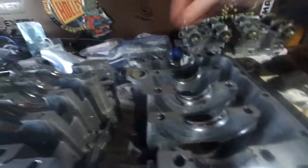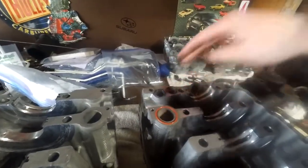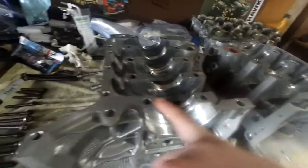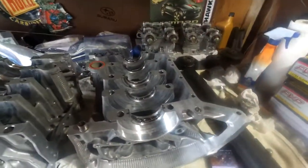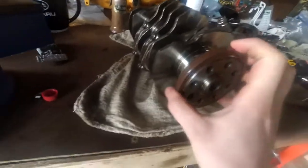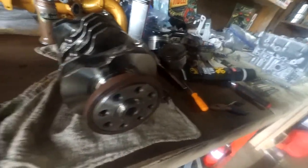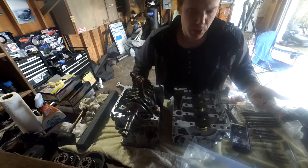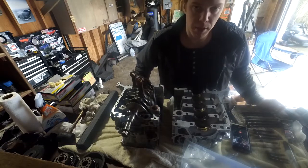I got a little assembly lube on there. I'm going to put the O-ring in here for the coolant passage, and there are three O-rings for the oil passages — just drop those in. I'm going to put lube on this side and put the crankshaft down on this side, then put all my RTV on this side so I can pick up the other half and put it over on top. What I'm actually going to do first is put the rear main seal on the end of the crankshaft — a trick from the machine shop guy — to make sure installing the rear main seal doesn't affect the RTV on the block. I'm using this Ultra Black RTV; some people use Ultra Gray, it's really up to you.